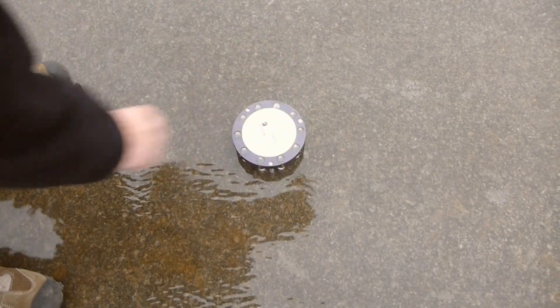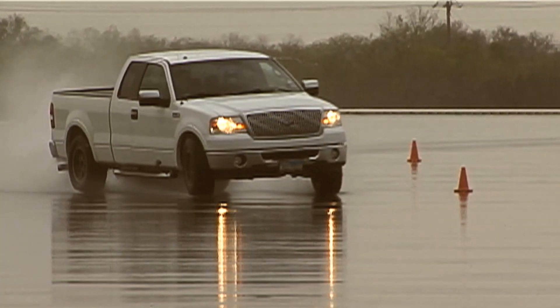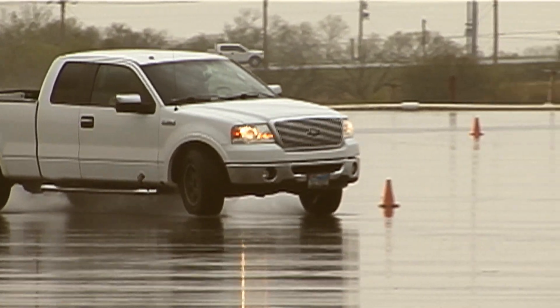Currently on the control tyre, Ryan explains what they're looking and feeling for: overall traction of the tyre, how much grip it ultimately has, and the breakaway characteristics — at what point the tyre starts sliding. Some tyres start sliding and are almost uncontrollable, while others start sliding but don't lose that much traction. This breakaway behavior is a very important thing they look at and emphasize.